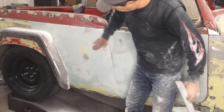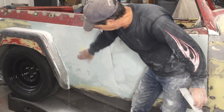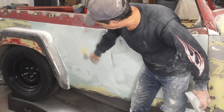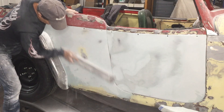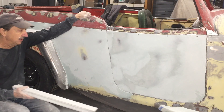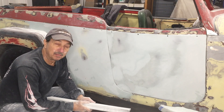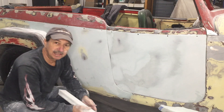You start to see my high spots — those would have shown up in the paint. It felt like it was really smooth and straight, and it's straight enough that it would have been okay, but this goes to show how much better it can be. I haven't gone all the way through the red oxide primer right here yet, so I still have a little way further to go but I'm really close. I am really happy with how this is going. Just to put it in perspective — this door and this panel, I've spent three hours, probably an hour more than is really necessary, and I have probably ten dollars worth of filler on the ground.